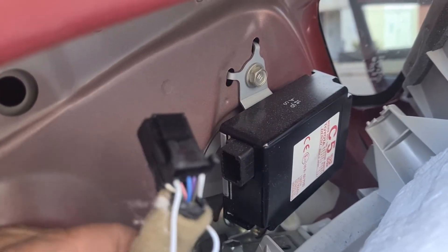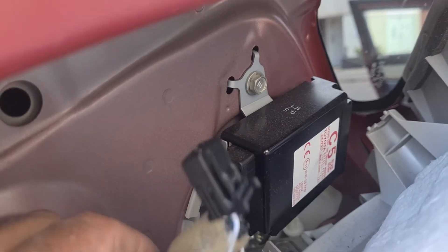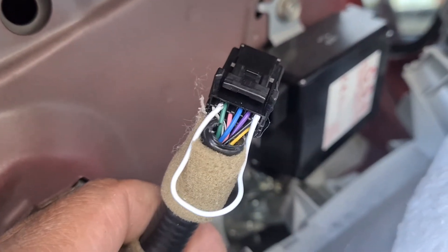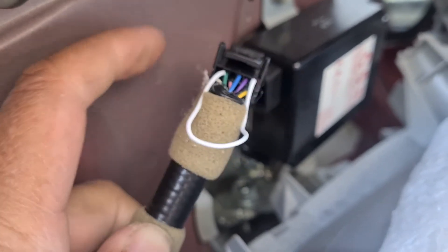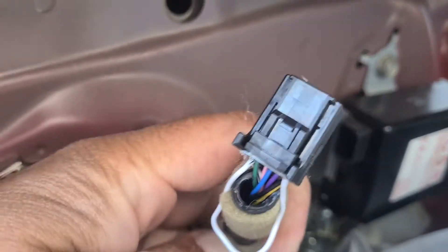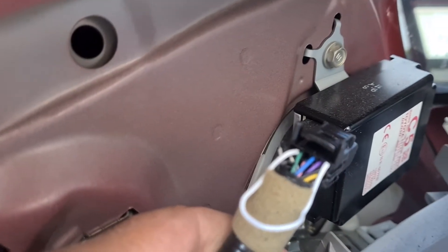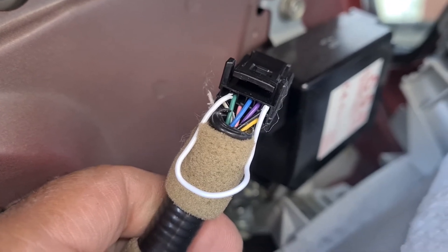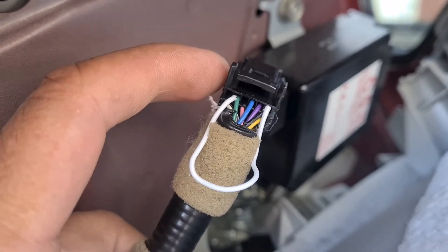The signal wire which transmits to the car's main ECU is this green wire on your left. If you look at it from the front, it's pin number two. The next thing you need to do is find a 12-volt signal from the same adapter.